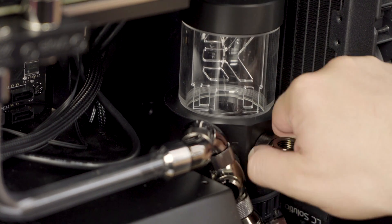I had to put an angular fitting on there. Be careful about fittings because they cost a lot of money. I had an awful lot already from previous builds — when you've been water cooling for some time you just accumulate these things. If you plan your loop and measure your tubing before you buy your fittings you'll save yourself an absolute arm and a leg. The fittings really are the thing that add a whole heap of expense. If you can't be bothered with bending tubing you can just use fittings throughout the build, but personally I don't really see the fun in that.